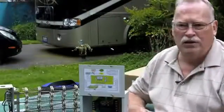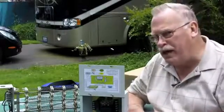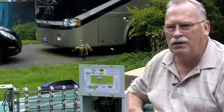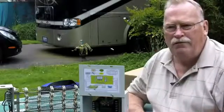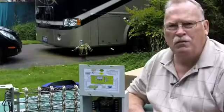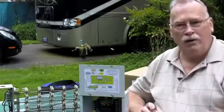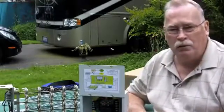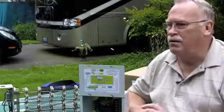You can look at the cost associated with electric versus gas, and whenever you do the math, you'll find that in the majority of cases, even if you were paying for the electricity, the electricity would be cheaper. But probably the most important thing is what it does to your heating system — it actually increases the life expectancy of the furnace. It reduces the temperature that the shaft on the motor is going to see and helps increase the fan motor run time and overall life. The comfort is amazing. With the gas furnace, you have a pre-purge and a post-purge cycle that tends to make the coach either too warm or too cold. With electric heat, that all goes away.